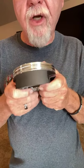We start the engine up and we let it run for 30 seconds. And then we'll turn it off. Everybody has seen these little infrared guns at the track or wherever. It has a little trigger, looks like a little gun, and it has an infrared scope. You can measure stuff. So I like to take that little infrared temperature gun and measure pieces on the engine and find out what was hot. One cylinder's hotter than the other or whatever.